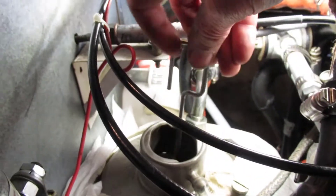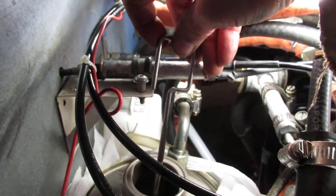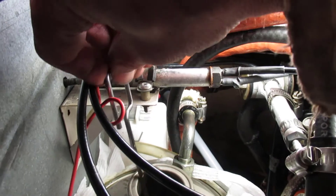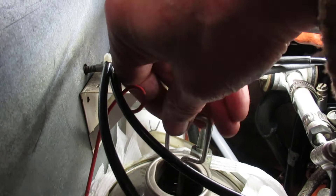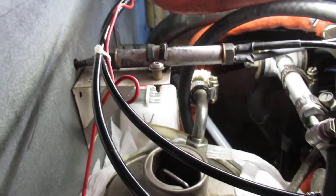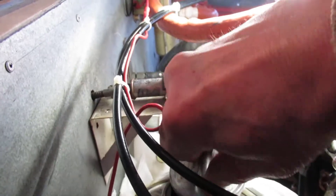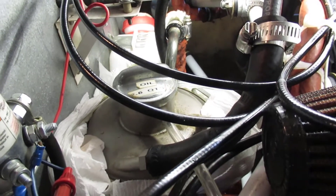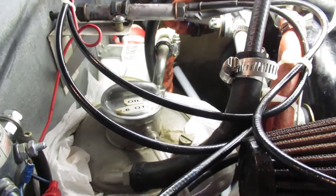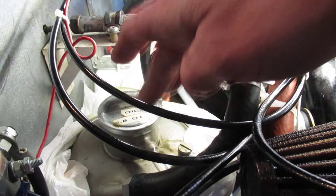Let's take a check on the level. It's about the middle of the flat area, so we're still good on oil — we didn't run all the oil out. There's probably a bunch in the crankcase at this point because the return is disconnected and I took the spark plugs out. Next steps are to reconnect the oil return line and the vent back to normal.